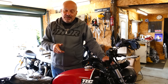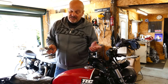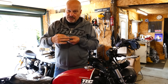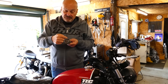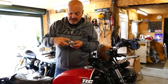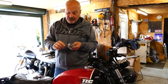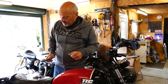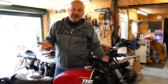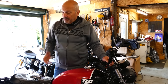One mistake I noticed watching the video: when you fit the sprocket, I put the tab washer the wrong way around. You should put it covering the pin so that if it came out, the tab washer would stop it — just good engineering. These pins are really tight and pressed in, so it probably wouldn't matter, but it's something I picked up on myself. We'll put all the technical details and dyno runs on the website, and if you've got any questions email me. These will be up on the website now for sale at a very keen price.